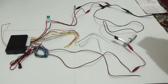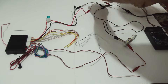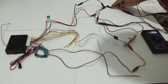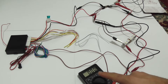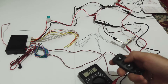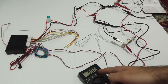Let's measure the power draw. Let's set it to amps and put the lead there for the amps measurement. Positive is disconnected: 0.01 amp. Now it's secured with a cable: 0.01 amp. That is 10 milliamps constant power draw from the battery, almost 10. Let's do some click sounds — 500 milliamps, 20 milliamps, 10.